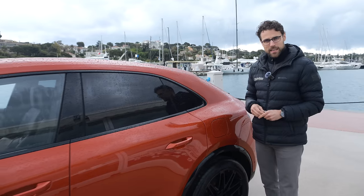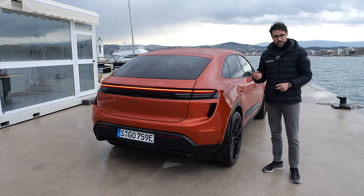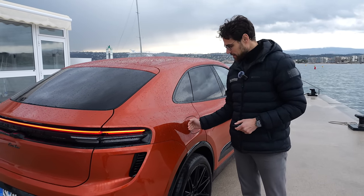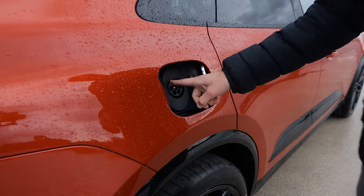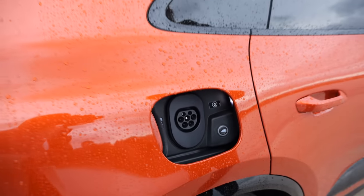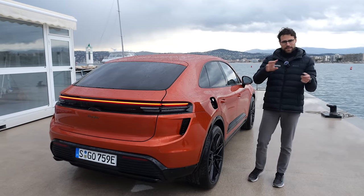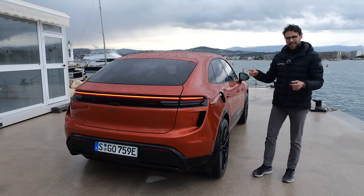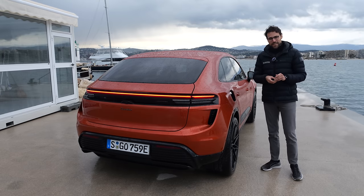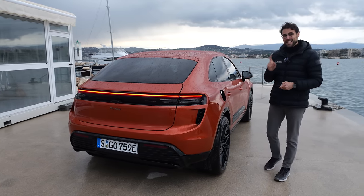800-volt architecture makes this one of the quickest-charging EVs out there. There's also a standard second charging flap on the passenger side, also opened via a sensor. The passenger side is AC charging only, and only one charging flap can be opened at a time — you cannot open both simultaneously. So you can't get more charging power by plugging in from both sides. This electric charging flap is optional; otherwise it uses a standard fuel-cap-style opening.